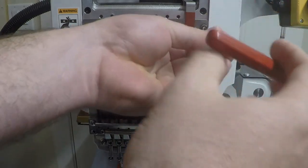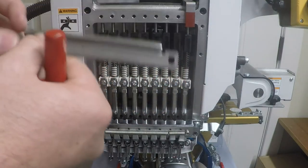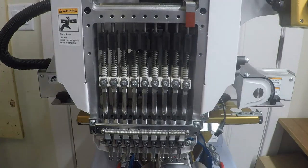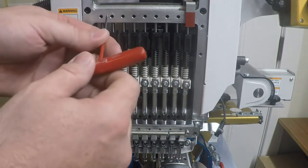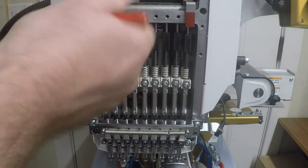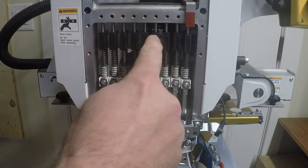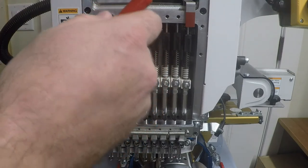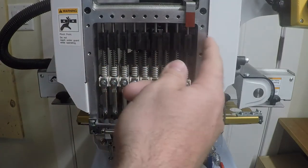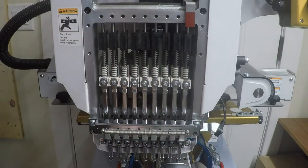Remove these couple of screws and set them aside so you don't lose them. Pull this little stopper out — it's just a stopper for the needle bars. Then take a two-millimeter allen key and put it in that slot; there's a little set screw in there to loosen. I'll remove about four needle bars so I can access things easier. Move the head all the way over to the furthest needle to give room above and below, so you're not hitting the throat plate.